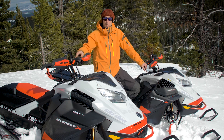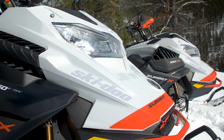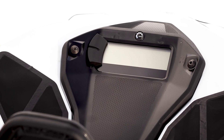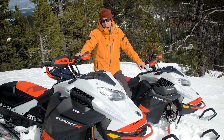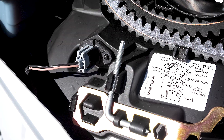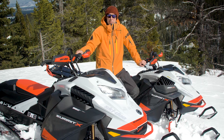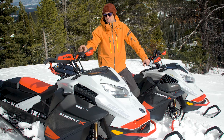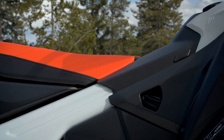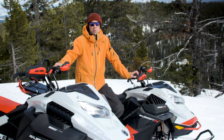So what's new on these 2021 Summit experts? They've got the lightweight hood this year — that's gonna be new on all of them. That takes about six pounds of top-heavy weight out of the machine. They've also got a 4.5 inch display, that's new. There's also a new belt monitoring system that measures the temperature of the belt and four other parameters, giving you a warning if the belt is being stressed too much. Also new for 2021 is an ultra compact lightweight seat, even smaller than the lightweight seat on the 2020 Summit experts.